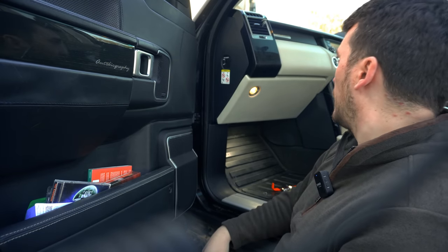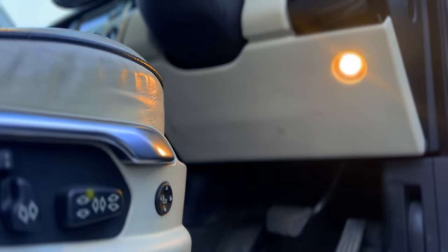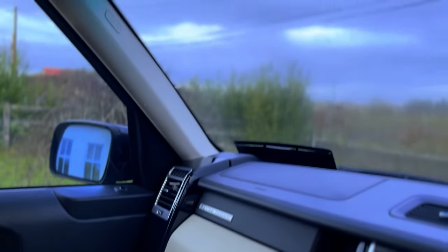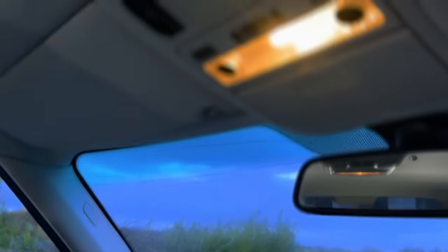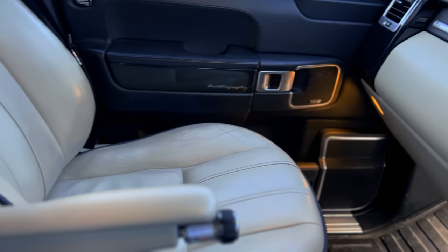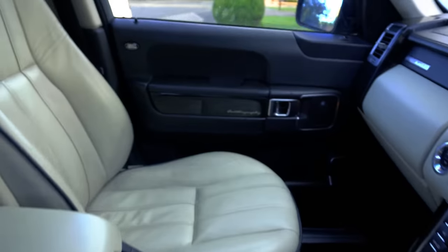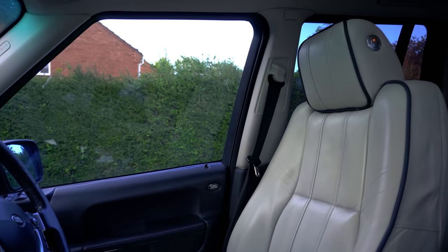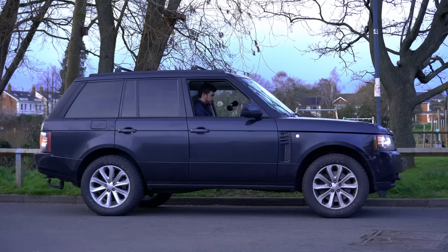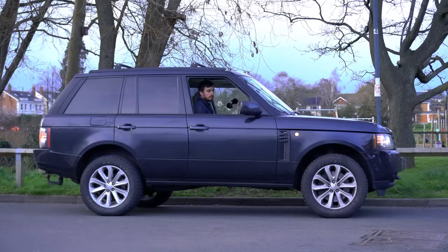By replacing all of these incandescent bulbs with LEDs we're actually probably going to save the battery a fair bit, since the power consumption is obviously a lot less — so if you're working on the vehicle with the lights all turned on, this might be just enough to save your battery. I'm actually way happier with these interior LEDs than I thought I would be. The key is definitely picking the 4300K light temperature ones if, like me, you don't like the bright sanitized look of 6000K white light on your sumptuous Range Rover interior. That's going to wrap it up for this episode — links to all the products are in the description below. Check out my Teespring and Amazon affiliates page for Range Rover themed gift ideas, and leave a like if you enjoyed the video. Cheers!